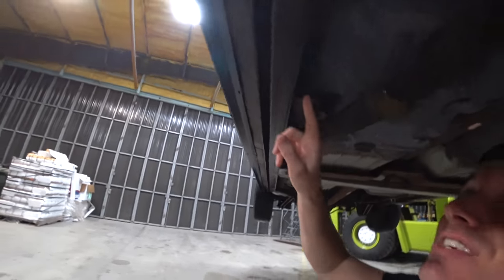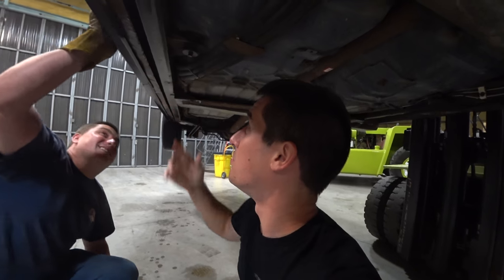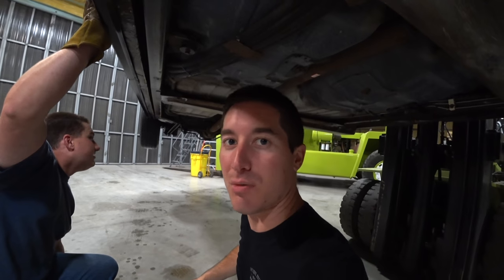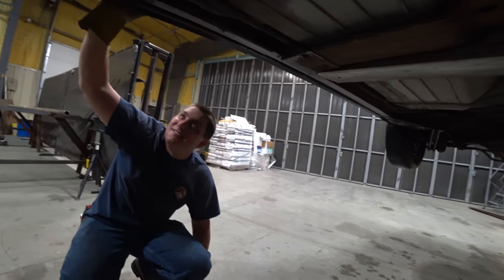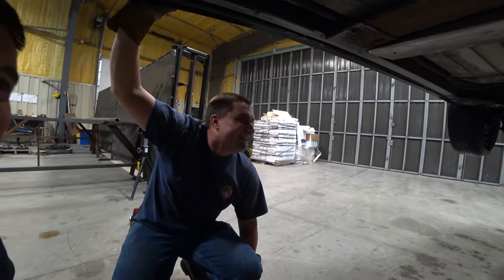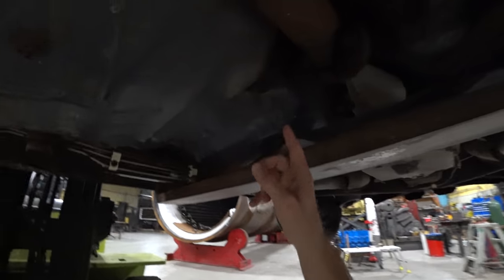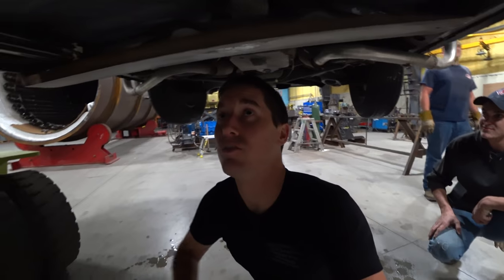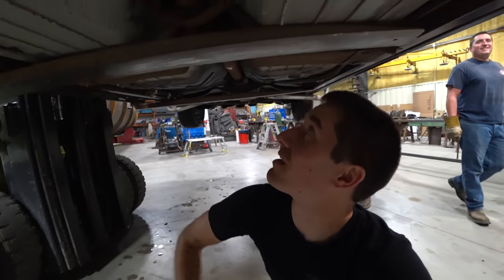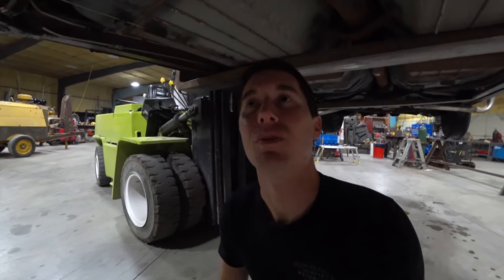There's a bit of rust on the oil pan and a little rust on everything — par for the course on this car. The frame extension is unbelievably well done: painted steel, beautifully done. I figured the frame would sag, but I don't think this thing's ever going to sag. It looks like the U-joint has probably failed — there's grease everywhere and a nicely rusted-out U-joint, so that's probably dying. It's got a two-piece driveshaft that somebody definitely hacked on. Driveline repair done in Olathe, Kansas — I bet they replaced the driveshaft for the pastor that owned it.